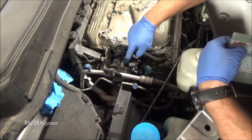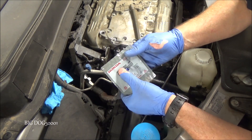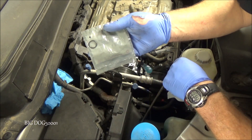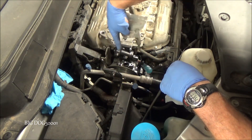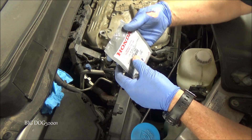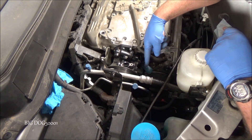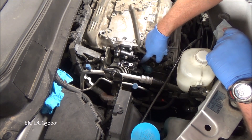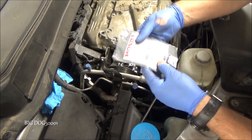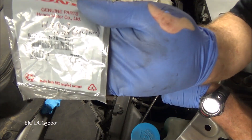There's one O-ring that connects right there, so we have to replace that — that is the outlet hose O-ring. Here's the part number: 14.4 times 1.9 millimeter. And then this O-ring — 14.8 times 1.9 millimeter — this should be the inlet or suction side and goes right down here on the pump. But it already comes installed when you get the new pump from Honda, so we don't need that one for this job. Just in case you're replacing O-rings or if this one is bad, that should be your part number right there.